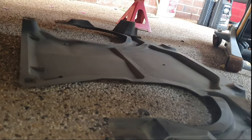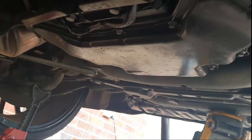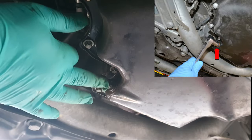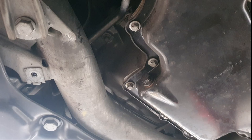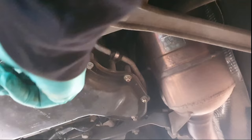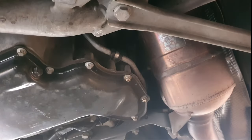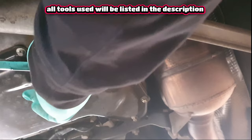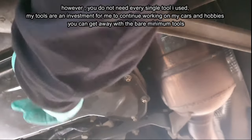The oil pan cover is now removed. That is your transmission, and this one right here is your oil pan. The sump plug is accessible — it's only a 13mm bolt. This doesn't have to be torqued really tight; a lot of shops overdo it. Just snug it up and about a quarter to half turn — that will do. Lefty-loosey, righty-tighty. I've got a 13mm wrench with a cool extension tool for extra leverage, and we go down to loosen it. Once it's loose we can undo it by hand.